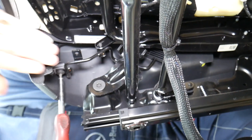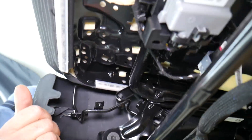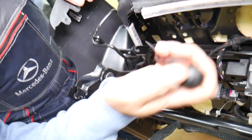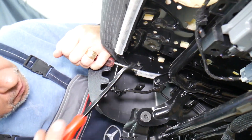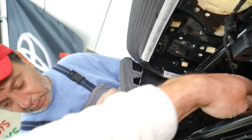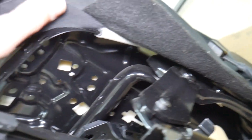For the bottom of the Tiguan seat, there's a screw — the driver's side back seat attaches the same way, without a zipper (that's only for the passenger seat). We work around the sides the same way, loosening the cover. Using a screwdriver to pull out the clips, everything comes loose just like that. We open the other side the same way, then flip the whole seat up.